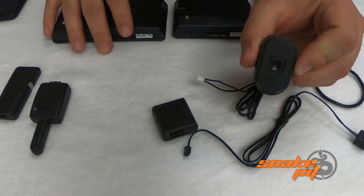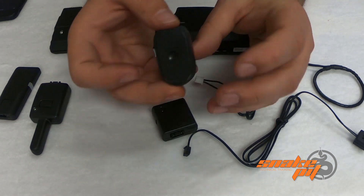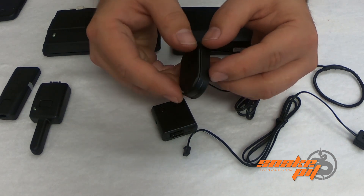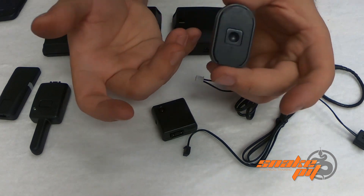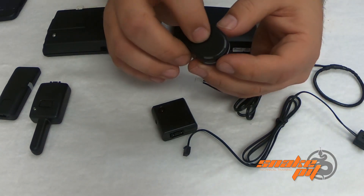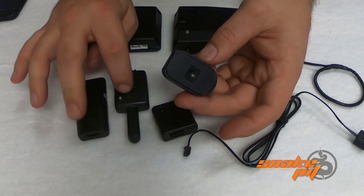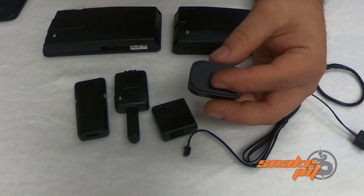Next, you'll see this in every box with either the plus or non-plus system — it comes with the interconnect cable for either an antenna or this. This is our 8620 valet LED pod. The valet button is on top and the LED actually has five different lenses for 360 illumination when mounted on the windshield. So if you're doing a three lock start or if the customer lost their factory remote or the battery died and they need to override the alarm in order to start their car, this gives them that option. Anytime you're not using one of our RF antennas, you would mount this. You don't need both because the valet button and LED is built into both of the antennas. This does not have RF in it — it's just there to pair Bluetooth to the DS4 or to do an alarm override.